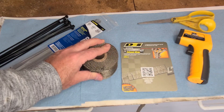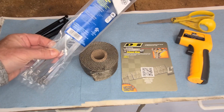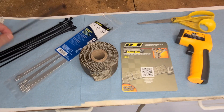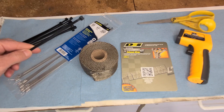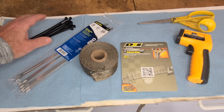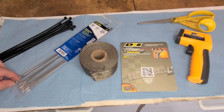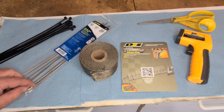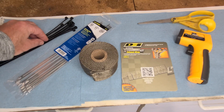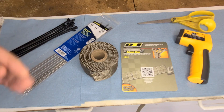This wrap is about twenty-six dollars at AutoZone. You'll need some metal zip ties because it's going to get hot - you can't use regular plastic zip ties permanently. We're going to use plastic zip ties during installation just to keep things from unwrapping before we put the metal ones on, because once the metal ones are on they're in and you can't mess with them, and they're not cheap.